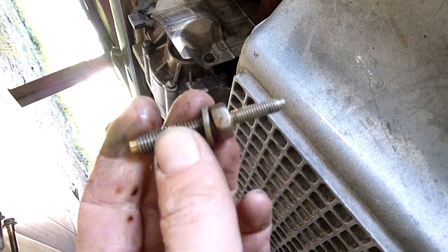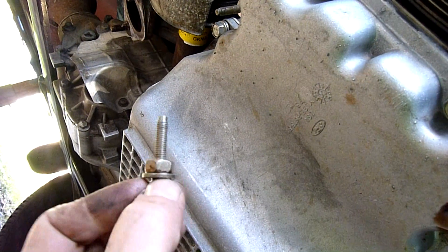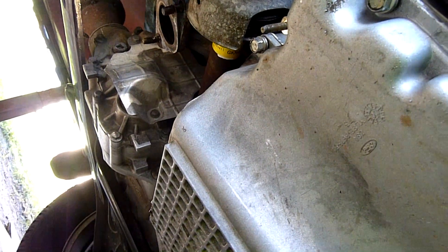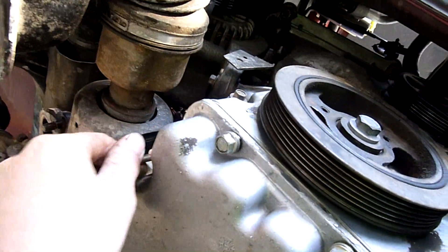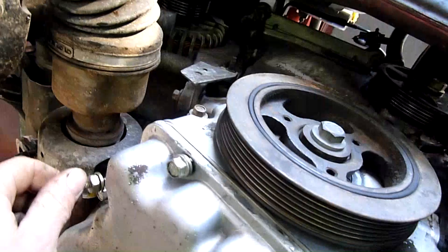Can't figure out why these have a 6mm stud on them, though — I'm guessing it's to do with an automated assembly process. There was nothing attached to them; they didn't do anything. There are 4 of them and they have the long stud on them. And for the most part there's oil on the supposedly dry side of the gasket, which is not supposed to be there.